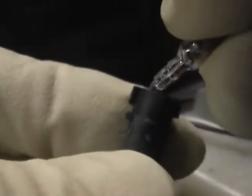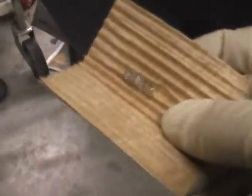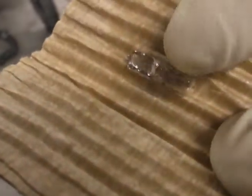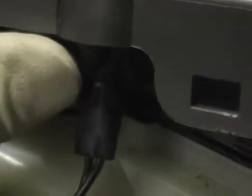That's what we're going to do. I believe this bulb just simply pulls out of the housing, pulls out of its little connector, and we put the new one in. Pulls right up and out like that — there it is. Now I'll get the new bulb and put it in. Here's the new bulb — this is how it comes from Subaru. So here it is installed: just put it through and gave it a twist.